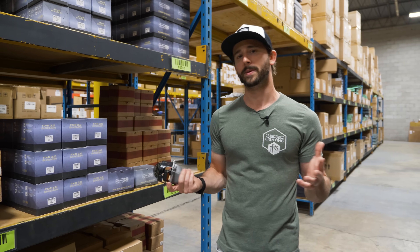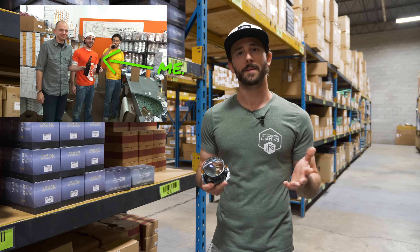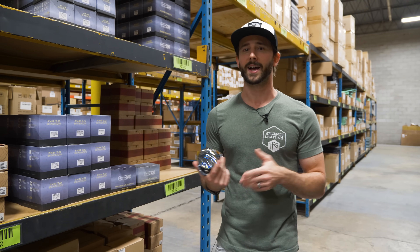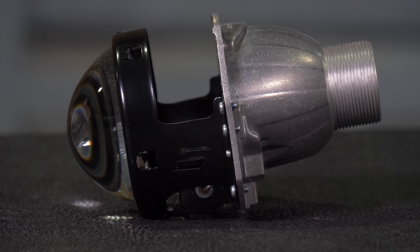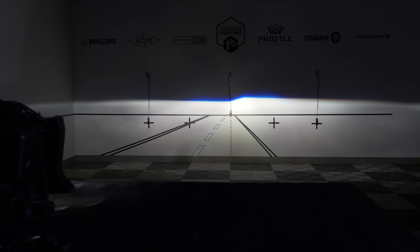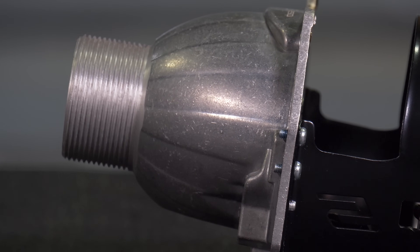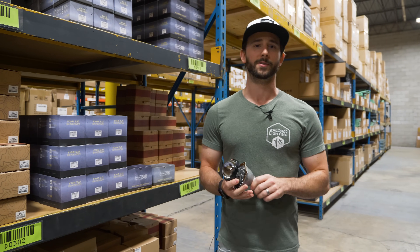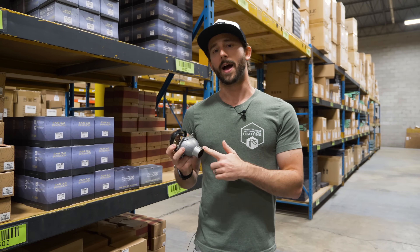OEM or aftermarket? This is a very common debate. Ten years ago I probably would have said OEM — the performance of those projectors, especially with a clear lens swap, was hard to beat. These days it's not so much the case. If you want to pack a lot of punch, you can do it with an aftermarket projector like the Morimoto Mini Series. These already have a clear lens, the cutoff lines are already tuned, the intensity is bright, they're super wide, and they're the only projectors with a threaded mounting shaft on the back — which makes first-time retrofits so much easier. Very easy and turnkey without tons of cutting or alignment.